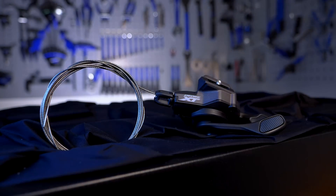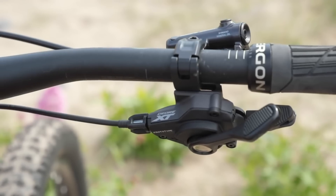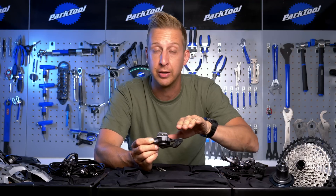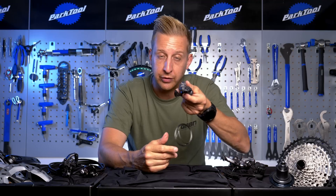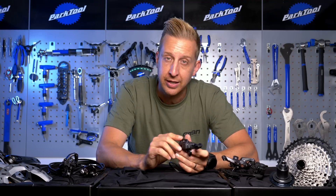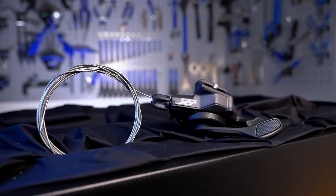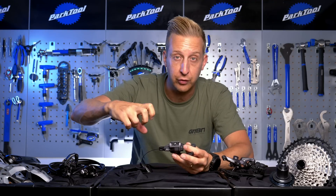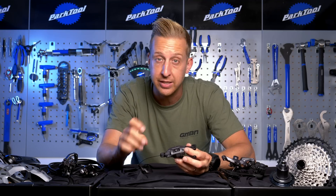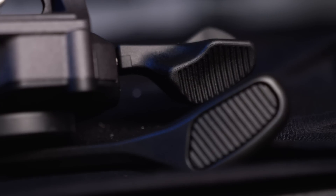The shifters are really quite cool with a few different options: the standard bar clamp model and the iSpec 2 model. There's 14 millimeters of lateral side-to-side movement available, so you can tailor the position on the bars depending on how inboard you like your brake levers. There's also 20 degrees of rotation available to really tailor the feel on the bars. Unlike the XTR, the thumb paddle here is quite a lot bigger with a larger rubberized textured grip, great for all-round use with no accidental slipping when changing gear. Shifting back down is a multi-release that goes in either direction, so some people can use a thumb and others can use it as a trigger with a finger. You can also shift two gears at once — the second click is slightly firmer than the first, so you won't accidentally shift two gears. It's there if you want it, and if not you can just trigger down one at a time.